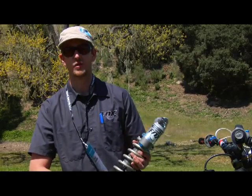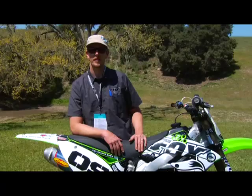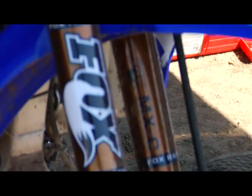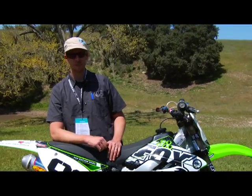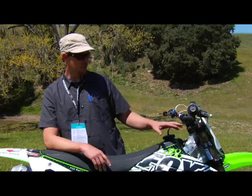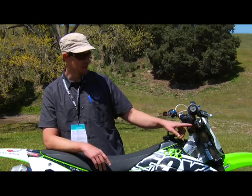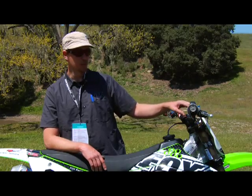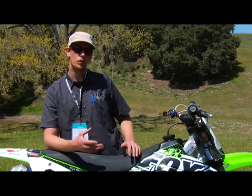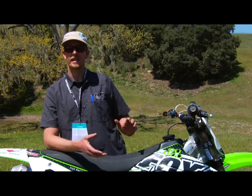Much easier to do, and only one tool needed. If you're going to buy a shock, you really need to do the fork also. For that, we encourage the customer to send in the fork to us, and we have three levels of product right now — we're calling it Protune. The first level is a standard revalve, where we collect information about your weight, riding style, and the type of riding you're doing. The second level is that same revalve coupled with some hard parts from Fox, including a top cap with tool-free compression adjust and a dual bleed port, which makes it easy to add oil to the fork. The third level is something we're working on — it's a little early to comment in detail, but it's going to be some level of new technology in a complete cartridge.